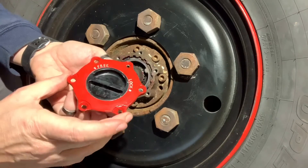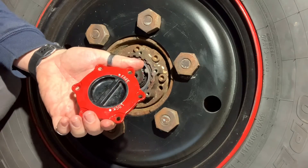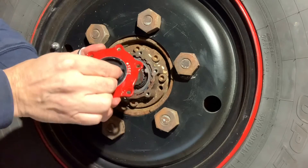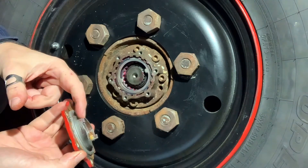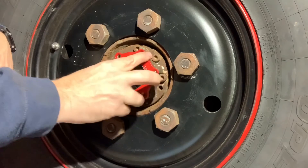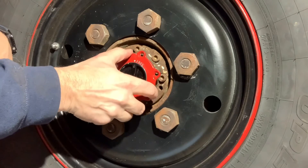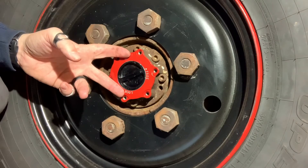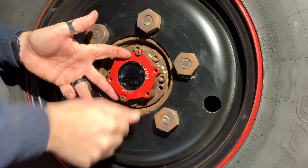The last step — we're going to put the face plate back on, and you're going to put it back into the free position. Even if you took it apart in four-wheel drive, it's going to be easier to put back together in free. New gasket on the back — I'm not putting a new gasket on because I'm going to be taking this apart again, but for you, new gasket on the back. When you have it lined up with free, ideally you can see that this is the sunken notch that's got to fit behind that tab. If you can't figure it out, just keep rotating this until it sits perfectly flat — that spot there is sitting nice and flush against the hub, and doesn't do that anywhere else.